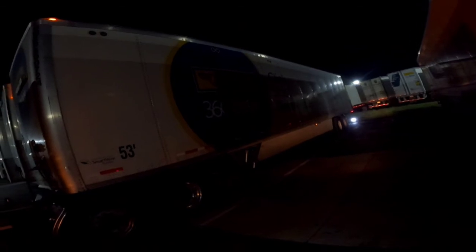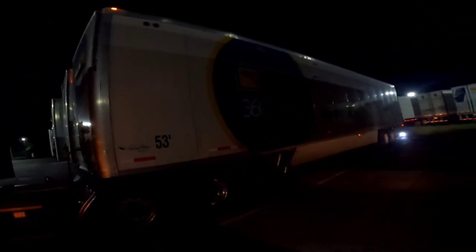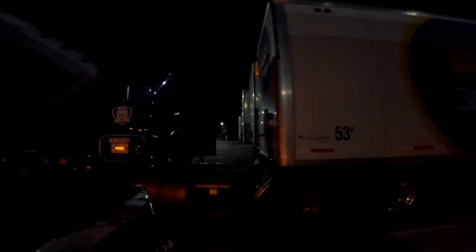See the little yellow light wants to go out. Okay, so that tick tick tick sound, that's the ABS module doing its test. If everything's working right, that light should go out. So that light went out. And we got all markers. Okay. All right, so let's rivet this thing back in and be done with it.